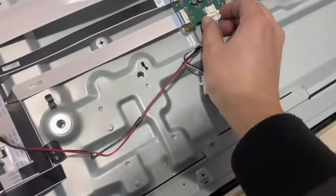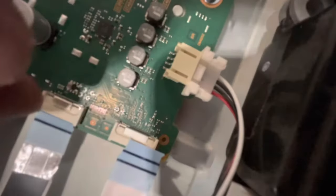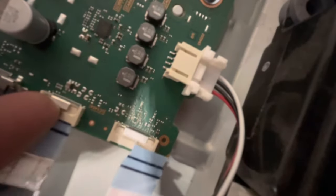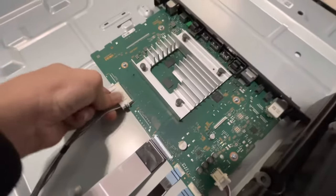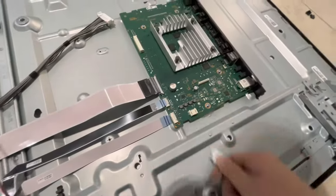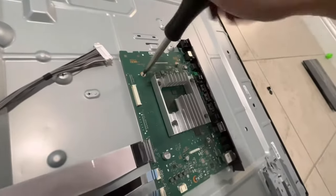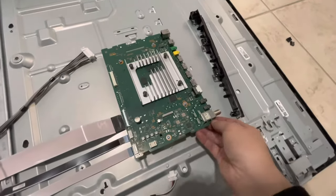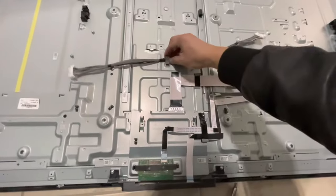Unclip this set of red and black wires. On the main board, lift up on the silver tab and then pull the wire out — same goes for this one too. This one just pulls straight out. Push down on the connector and then pull out the wire; push down and pull out this wire as well. Remove four silver screws from the main board, then pull up on the main board and it comes right out. Unclip the main-to-power board wire.